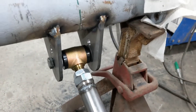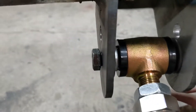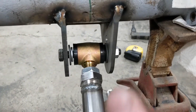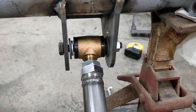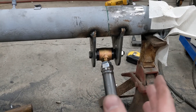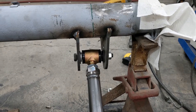Here's a little preview — I burned in the end on one of these tubes, so you can see I've got a little bit of room side to side. I wanted to be able to have room for that small washer so that this can rotate a little bit, because the rear end is going to have to go back and forth. If it was captured too tight with the polyurethane, I don't think that would articulate very well. This allows me to get my placement just right so it doesn't bind. Obviously, if my mounts aren't perfect left to right in the car, that's going to be figured out by the panhard bar, but I'll be able to adjust the lower control arms to make sure they don't bind if I didn't get my mounts just perfect.